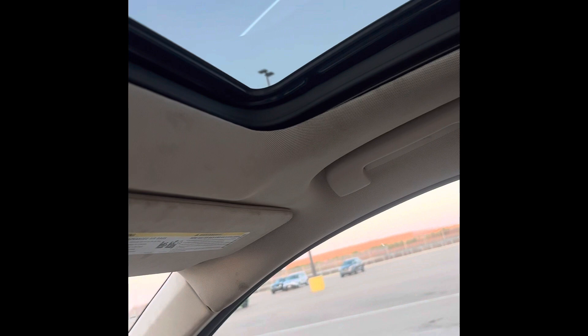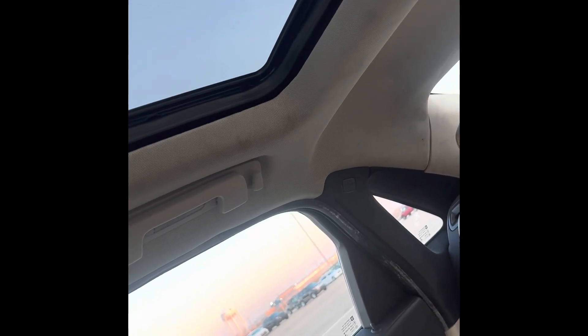So basically I'm trying to teach everybody what you should do. In order to access this, like if something was wrong with this front headliner here, you wouldn't have to take the headliner down — you would just have to take the bolts out of this glass. And then you would be able to get the sunshade from the top. You can get the sunshade from the rear too. The only difference with the rear is there's no access point. Because even if you hit R, it's going to open it up and you can get to the top glass, and you can see the bolts where the top glass is.